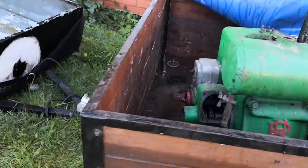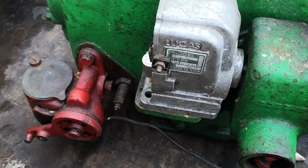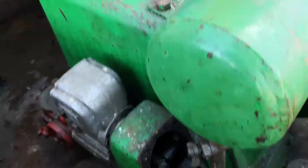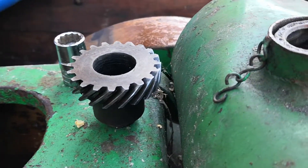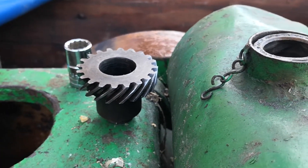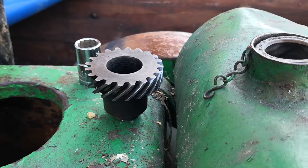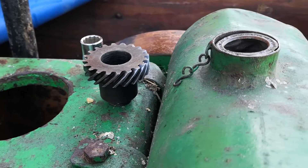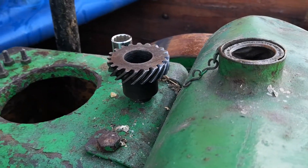The flywheel face needs a bit of a clean up, but that's the least of my worries at the moment. What we're going to do in a second is get this skew gear and just put it into the assembly and loosely put the nut onto it, because I need to move the magneto spindle around so the points are just about to open.